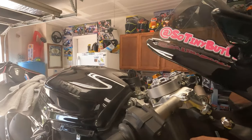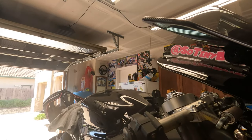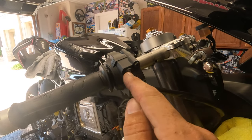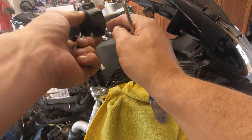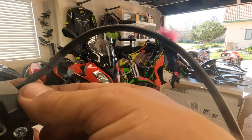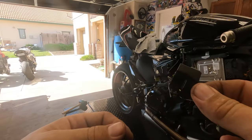Now that we're done with that, we're going to go ahead and I don't think we need to unplug this, but let's unscrew the backing because with the throttle, I believe we're just going to cap over — we don't even need to move the throttle. So let's unscrew the back and this should come out and we can keep this all intact. So we've got three screws removed from the back, and then you're going to have to snip this zip tie here, and then the back cover is going to come off. I believe we're reutilizing this — it looks like, correct. So set this one aside and we're going to reuse this.